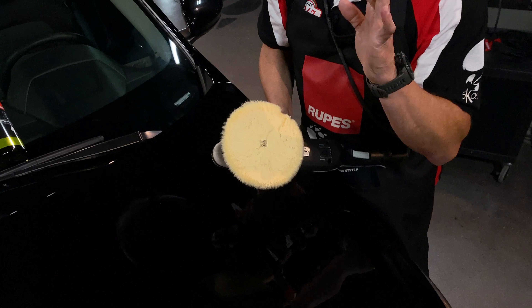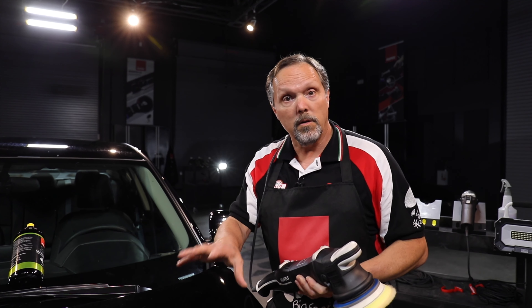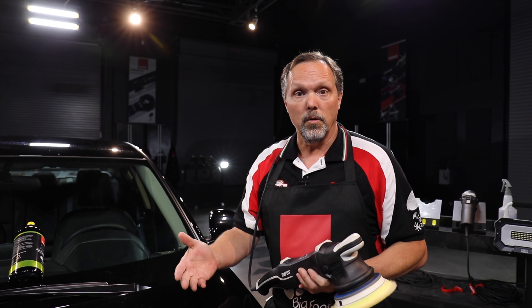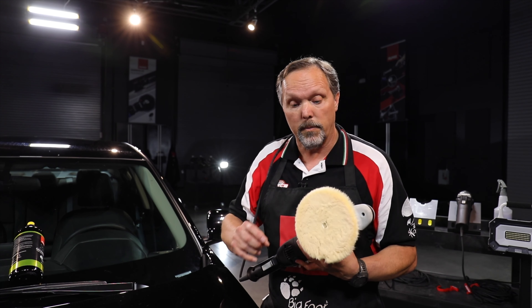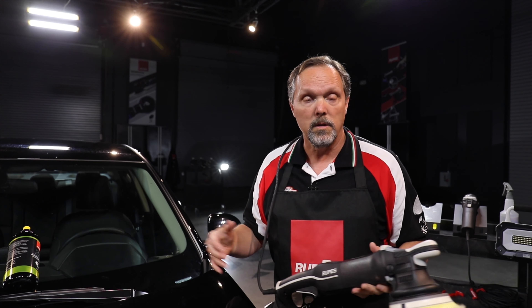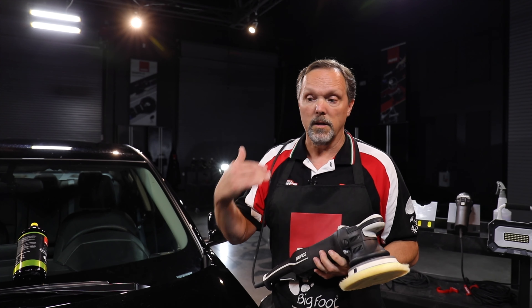Once you complete that runtime you can see that the liquid product is thin and even, and the fibers have now laid themselves down into the pattern that the tool makes — you are primed and ready to go. Another reason for the additional run time is that a brand new wool or microfiber pad on its first use, even after doing this priming step, might feel a little bit of wobble in the first few seconds or the first minute of runtime. This priming step can actually help these fibers orient themselves to the movement of the tool, which will help smooth it out. So you might experience a little vibration or wobble in the beginning, but it will smooth itself out as soon as those fibers get oriented to the tool.